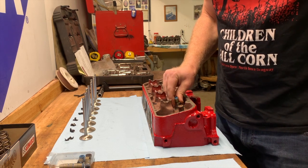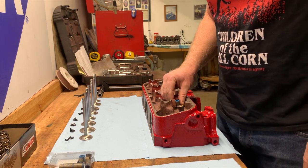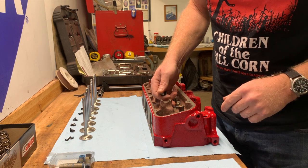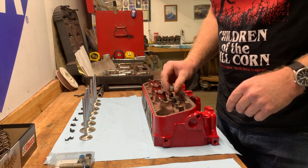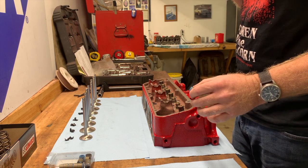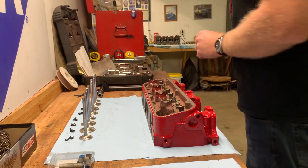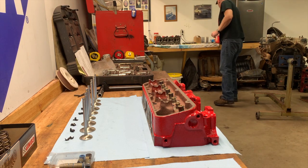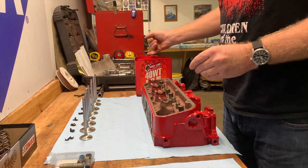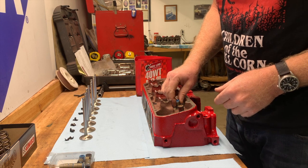they get tight. Well, I looked at how you actually install these, and they're a little bit different than a regular valve seal, because the press fit inside the valve seal allows it to stay in place on this machined guide. So I had to look and see how to install them, and come to find out, the LS head is very similar in these regards. So first thing I do normally is put a little bit of oil on there to lubricate it. All right, once your oil is in place, you slide it down on the guide.